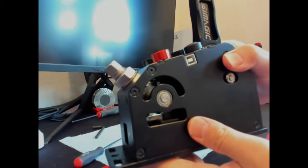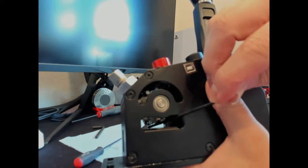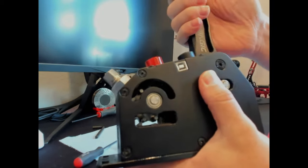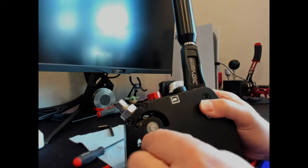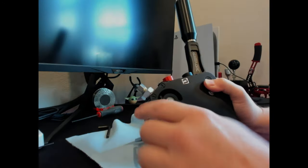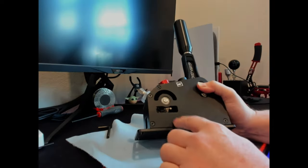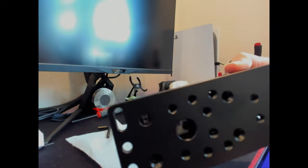To fix the other problem — as this moves forward, this bottom jaw here will not engage. It's not pushing up high enough to engage the star. You can push it in and it pops up a little bit, but it's not quite engaging the star. To fix that, take the bottom plate off. You can actually already see the spring is poking out the bottom plate right here — it came out of that little shield.